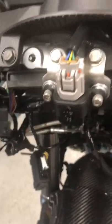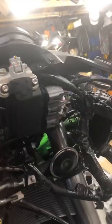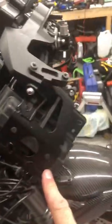and then you have this little clipped in around the headlamp unit, which will need to be pulled out, or you could take the plug off, but I found it easy just to pull the rubber bung out. And now the headlamp comes off with it, and this is what's behind it, obviously. A couple of control units, relay switch, relay boxes, and that. You've got your ECUs here, in the fairing, which is one part I'm going to have to change when I change the loom.